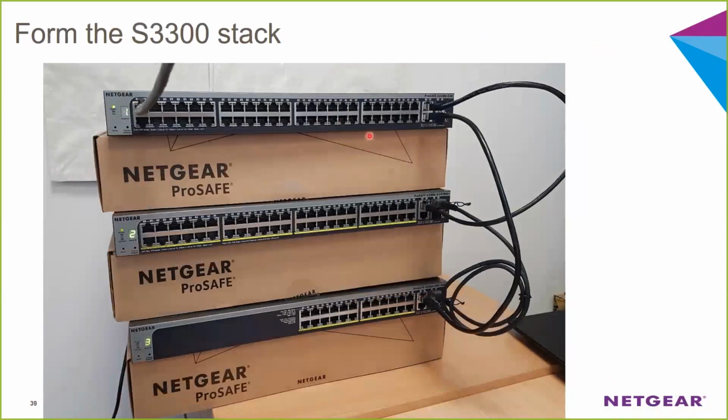We power the second switch, and we are going to wait for maybe 10 to 15 seconds before we power the third switch, so that we know that the second switch will arrive after the 100-second boot time in advance, and we are going to facilitate that switch discovery, because that guy, the first switch, is perpetually trying to welcome new members in that stack.